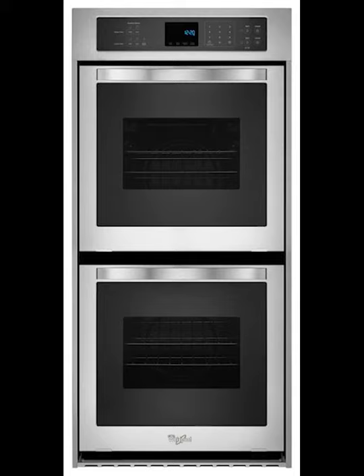On this double oven it had a different, strange issue. Both ovens turned on, the bottom oven worked properly, but the top oven only went to about 270 degrees — the customer stated that when I got to the house. I checked it, got it up to about 200 degrees over the course of about five minutes. I could feel heat from the bottom heating element, and I did not have any faults on the control board when I went into diagnostic mode. I turned it on broil and didn't get any power from the broil element at all.